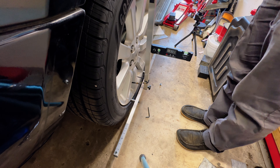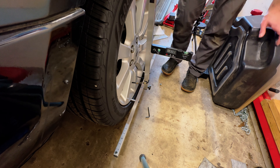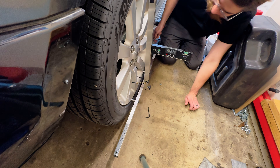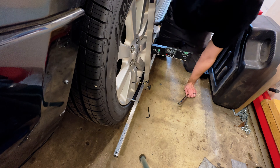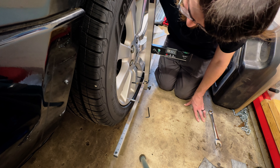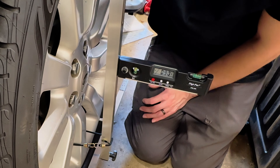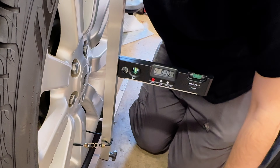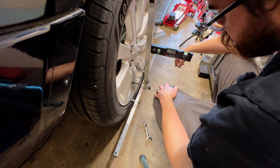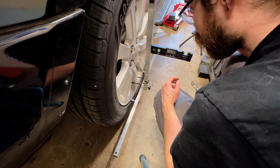Let me see if I can adjust it to be at exactly one degree. It turns out you need a fair amount of strength to move that. I'm reading one degree now — I've readjusted and that seems okay, that means it's in spec. Now the challenge is going to be to re-tighten that without anything moving.